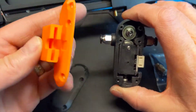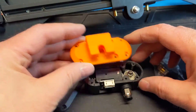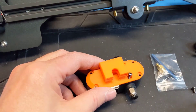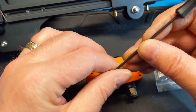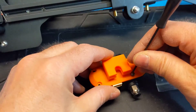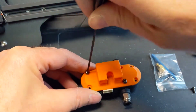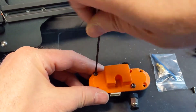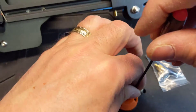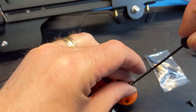I'll put a link to this cover in the description underneath the video. Line up the holes. I put all the screws in loose and tighten them up at the end — that kind of comes from working on cars. If you put the first screw in and tighten it, inevitably one of the other screws won't fit because it's misaligned a little bit. So it's always good practice: get all the screws started, then tighten them up.